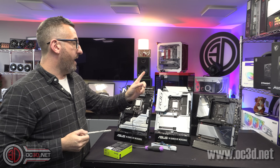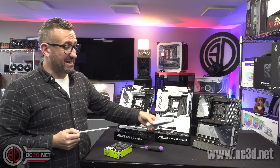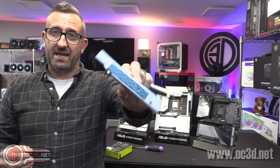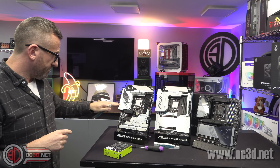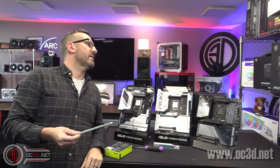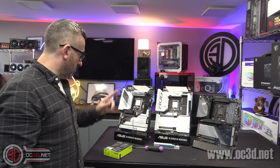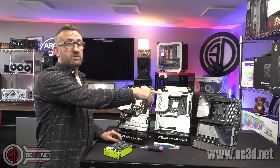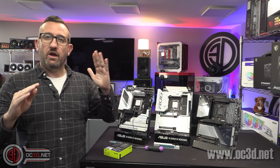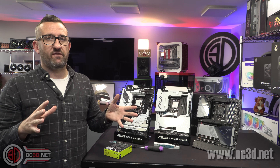With the Dark Hero and the Formula, you can't even fit it. And honestly, I don't think the Corsair heatsink is going to cut the mustard anyway — I think the drive would overheat. On the Z790A Wi-Fi the heatsink is tiny; I didn't even bother testing it there because I knew it would overheat. With the Gigabyte Master, however, I did test it, and that heatsink was capable of keeping it below the throttle point — but only just. We were seeing 74–75 degrees under punishment.